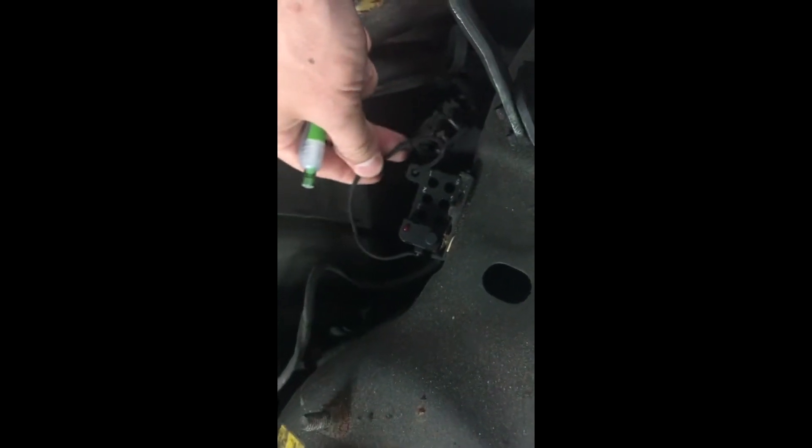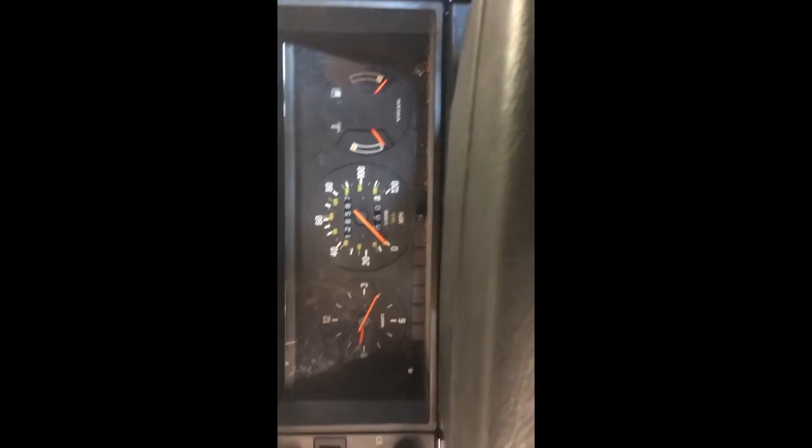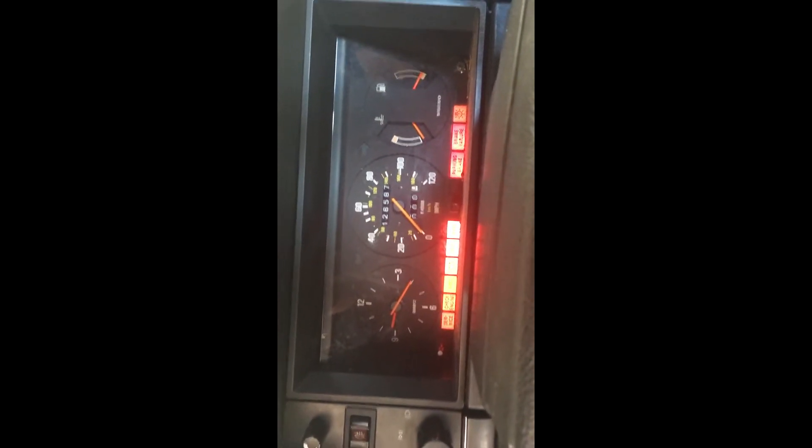Take this thing out from inside and put it into slot 2. Slot 2 is for checking engine codes and transmission codes. Come over and turn on the ignition to position 2. You also want to remove and turn off everything — the radio and so forth.